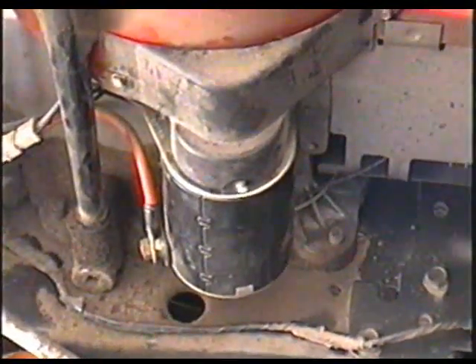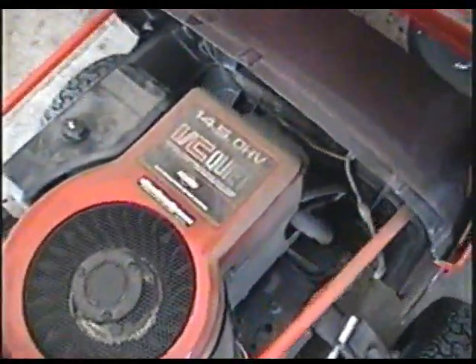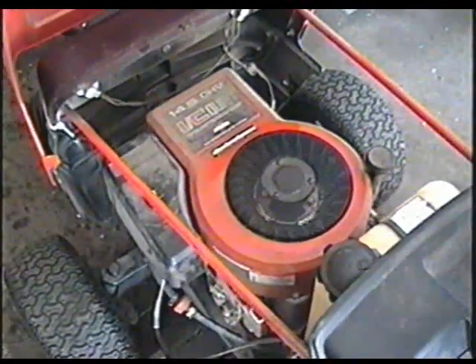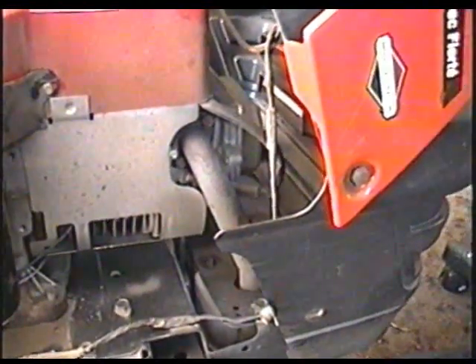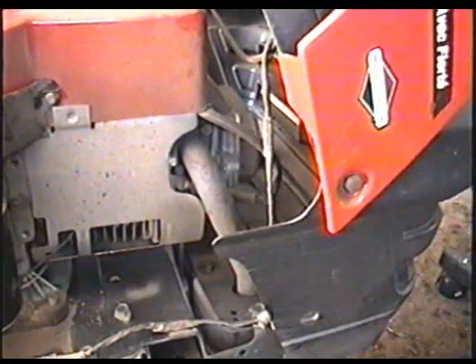At this point people would think they need to replace the starter, but I've seen people do that and only end up with the same problem again. What happens on these overhead valve engines — you can see the cover over here at the front — it's not just a flathead like the older ones. The valves haven't been adjusted since the guy bought it brand new, about 15 years or more. As part of regular maintenance they do need to be adjusted. The valves have gotten out of adjustment, therefore not releasing the compression in the engine when they should — not opening when they should — thus creating too much compression inside the cylinder chamber and making it almost impossible to turn over the engine.